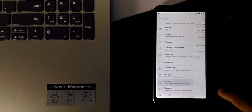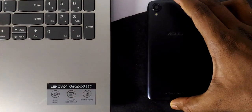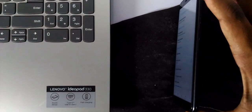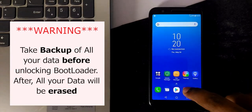Find the link in the description and download the Asus official unlocking app. Before that, note that unlocking the bootloader will cause data loss — once you unlock the bootloader, it will delete all your internal files and make the device like a new one. All the settings and preferences will be gone. So kindly backup all your apps, files, and contacts.